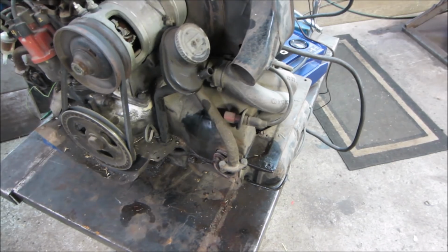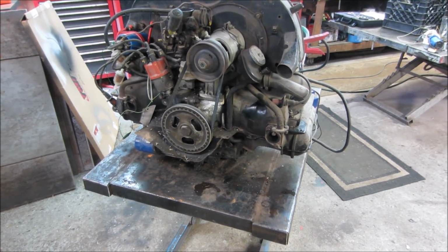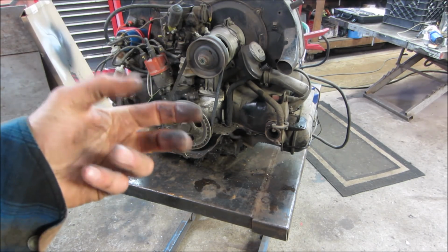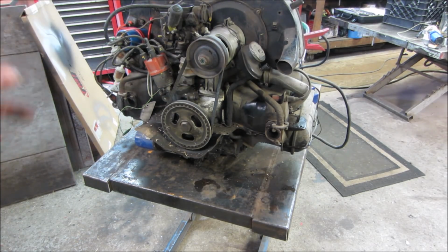Also, sometimes people ask, on some of the other engines that are really hard to start and have been sitting for a long time, why do you crank it so much? Why don't you just throw some ether in it and fire it up? It has nothing to do with the fuel delivery it's getting. The problem is when they sit for a long time, the compression is low, and to get the compression up, it just needs to cycle some. If you were to take the engine apart, the surface of the edge of the valve just has rust on it. It needs to kind of hammer itself a couple of times to get that stuff cleaned off. So that's why they fart and cough and start popping. One cylinder starts firing a little bit, then another one kicks in. It's the nature of it. You can take it apart and clean it all, but if you just spin it a bunch and put some fuel and oil in it, if it's a savable engine, it will come back on its own. So that's why that gets done.